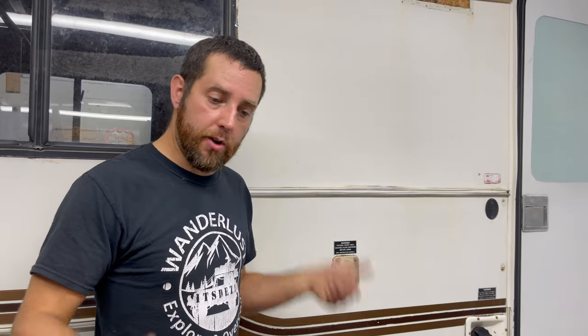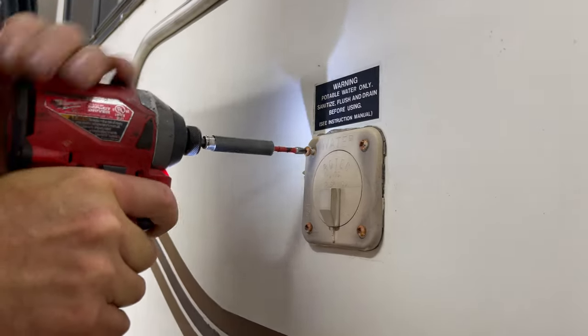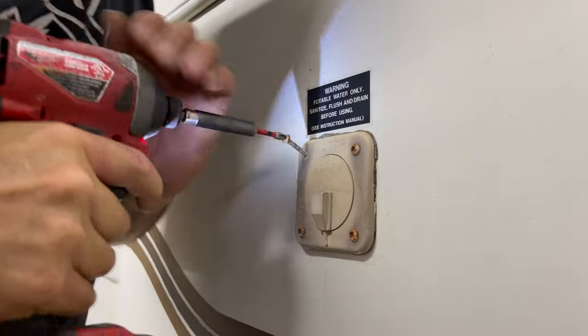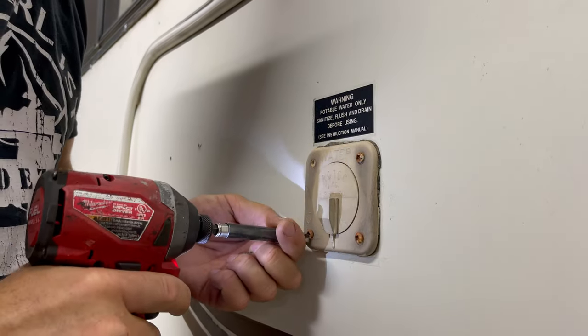And then on the other side, it's already got a hole. So we're going to basically crib it with some wood and make blocks sticking out of the side of the camper body to be able to grab it with the automotive lift, and then block the front and do the same thing. That should safely get it up and down, and we'll be able to tie the lift to the camper so it can't possibly fall off, because once it's off, I really don't know which way the weight's gonna wanna go, so I have to make sure it's like part of the lift. This is an indication of how this is gonna go.